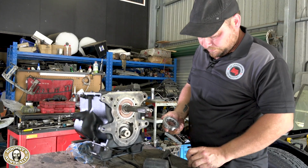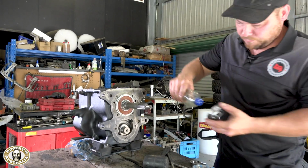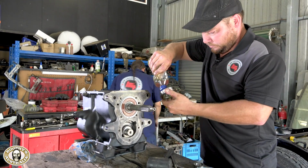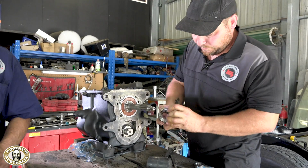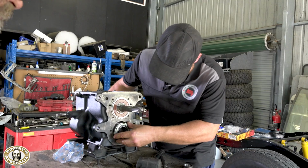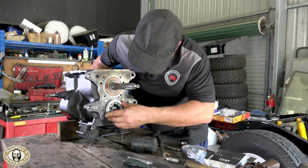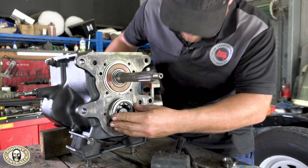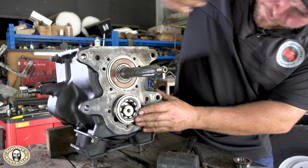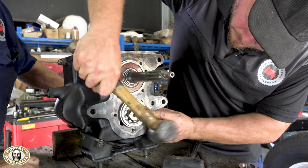Okay. So what's that? Oh, that's the bottom bearing on the... Yep, the bottom bearing on the front of the gearbox. Now, that goes on, the race is actually part of the lay shaft. So you see the bearings, they're open. So it's like an open needle roller? That's it, yeah. And that should just pull up. It's quite awkward to get the gears all meshed to get it up and pop that in. So when it's awkward, you just get a bigger hammer, or a bigger nylon hammer.